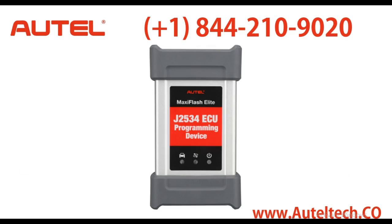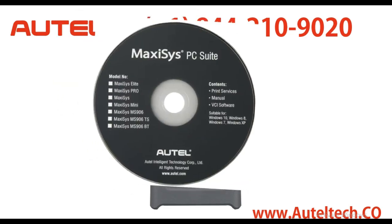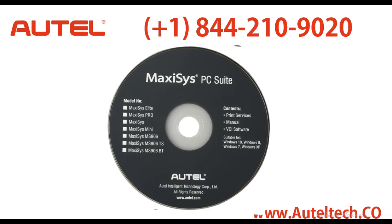As you can see here, this is called the MaxiFlash Elite. It comes with the MaxiSys Elite and MaxiSys Pro kits and is used for two functions: one, to do your normal diagnostics, and two, to do your programming with the J2534 protocol — it allows you to connect to the manufacturer's site to inject the calibration file into a particular ECU module. Normally, most customers install the CD that comes with the kit, but the problem is sometimes the CD comes outdated and it will conflict when you're doing programming. It's important to have the most updated drivers and software when doing programming.